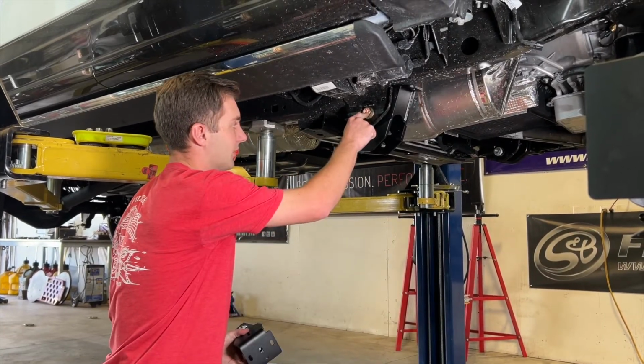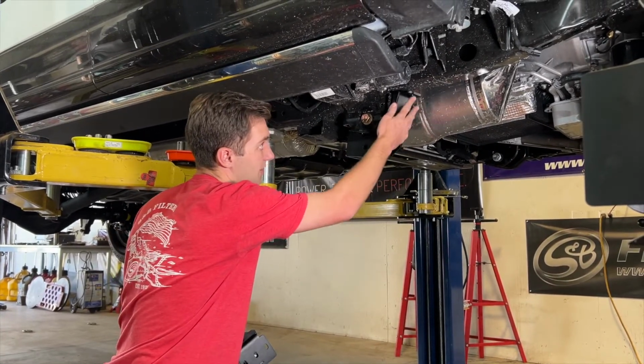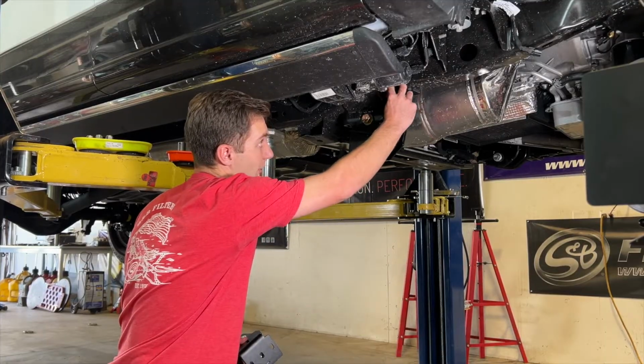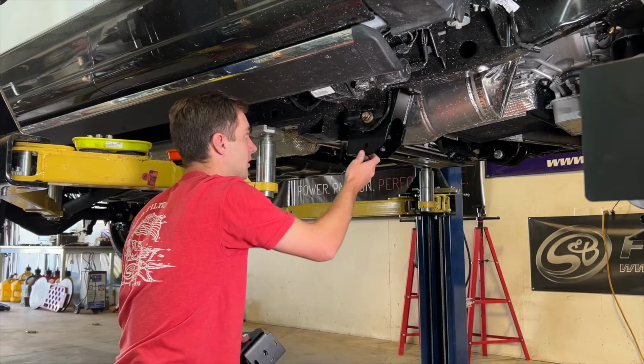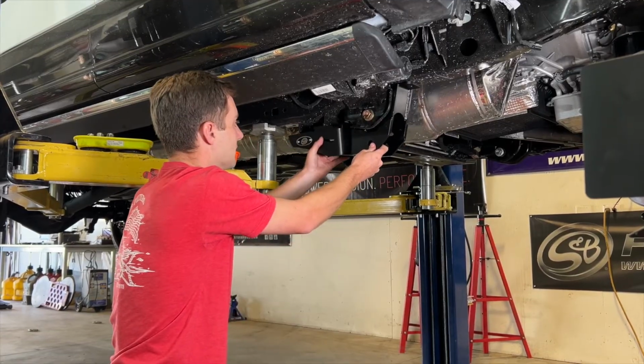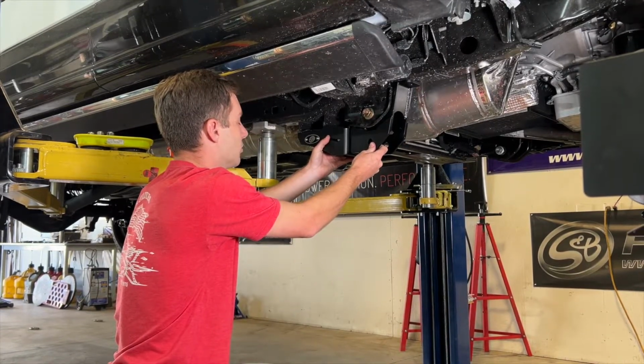So we bolt in from the side here. The other side, we have the additional bolt we're going to drill for, and then the whole radius arm drop sits flush against the frame up here and is able to transfer force upwards. And then the rear section, which will lock the whole thing together.